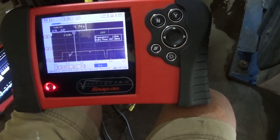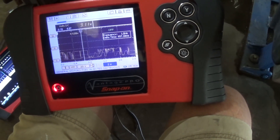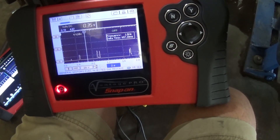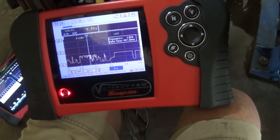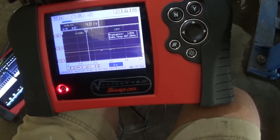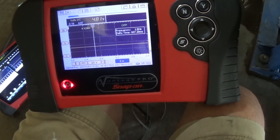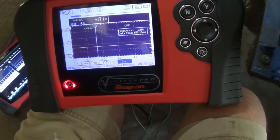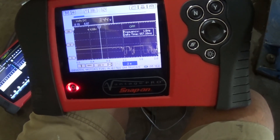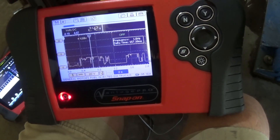The problem is pretty much the whole way from that point up to this connector — it's dropping. And when I stress the connector it's dropping as well, although actually not as much. The connector itself seems to be okay, but right in this harness, even here, it's causing a problem.